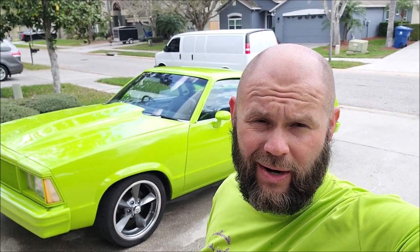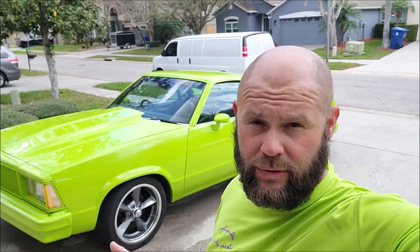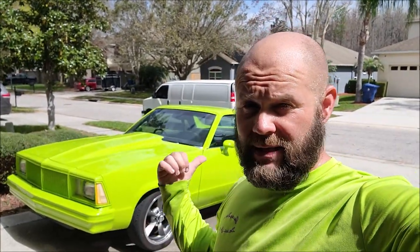Thanks so much for watching, guys. I appreciate you taking the time. I try to only show you guys stuff that matters instead of being long-winded. I got the car washed and we used five and a half gallons of water, which was pretty cool. I would not do this unless you have deionized water or you're out of the sun, because you're going to leave water spots everywhere and they'll be difficult to get off if the sun bakes them on. Deionized water is mineral free, so you can let it dry in the sun and you won't get any water spots. Check out Gary Dean's Detail Juice Nation — it's a group on Facebook where we talk about my products, my processes, and what I've got going on. Thank you for taking the time to watch this video and have a great day, guys.